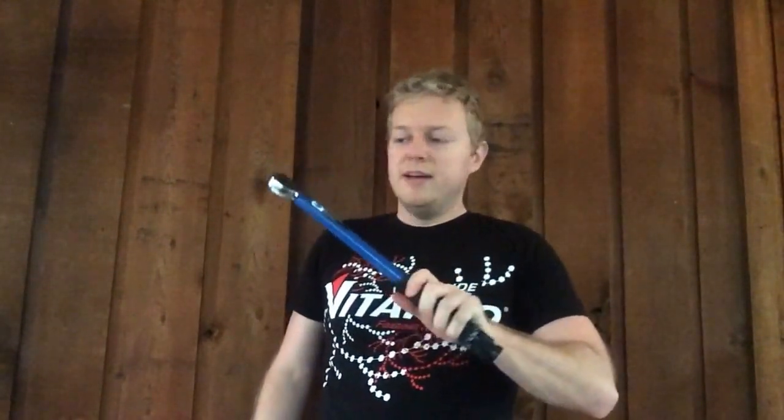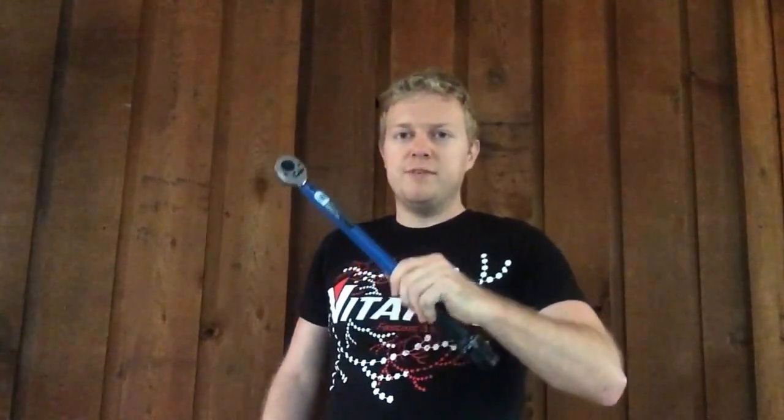This is one of the most important tools that any bike mechanic can ever have. I'm so crazy about torque wrenches, I not only have this one, but I've got its big brother, the TW-6, which goes from 10 to 60 newton meters. That one is awesome for tightening bottom brackets and cranks and whatnot — not a ton of uses, very specific tool, but highly recommend it as well.